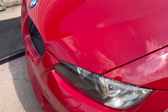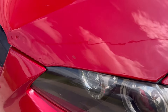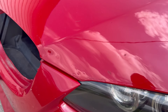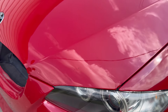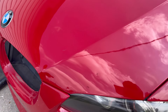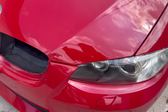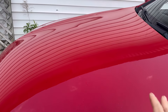The car looks mint from afar in the videos I posted previously, but you can see there was a hit somewhere on the hood. When I got the car I lifted it up a little bit because there was no gap to begin with. Since this is the only flaw in the hood, we're going to try to save it by pulling it out a little more and using some filler to make it look new. You can't really tell because the paint is so glossy, but there's a lot of hail damage on the hood.